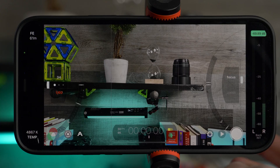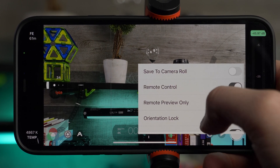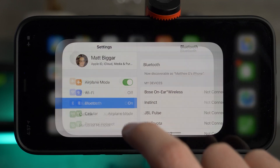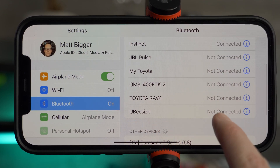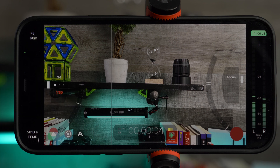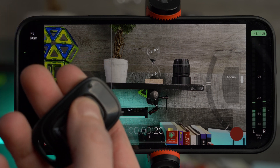You can use a cheap accessory from Amazon to remotely start and stop your recordings, which is handy when filming by yourself. This one from Ubisize has a switch on the side and can control both iOS and Android via Bluetooth — pair it with your device first. Open up settings, go to device, scroll to the bottom, and turn on 'volume keys trigger recording.' If you've turned on airplane mode, make sure Bluetooth is still enabled. Now you can start and stop recordings remotely, which is especially useful when using the rear cameras and you can't see the controls.